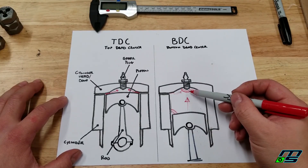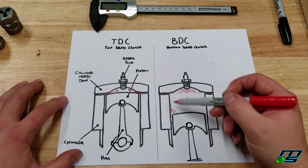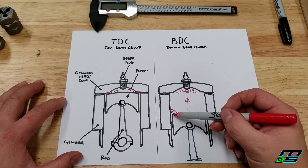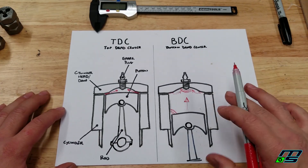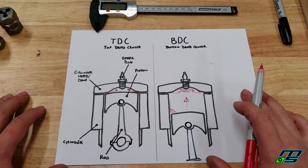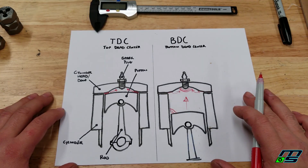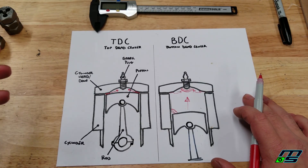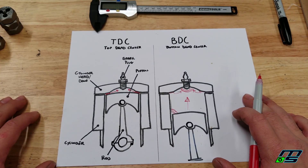This is really where you want your explosion to start — with the spark of the spark plug. When you have detonation, up in the corners of your pistons because the compression is so high, it can create hot spots. The edges of your piston get really hot, and that's when you get detonation. That causes those little pits that you saw in that picture of your dome. Those edges can get red hot, and that actually causes detonation and pre-ignition because the fuel and air mixture explodes before the spark plug goes off.